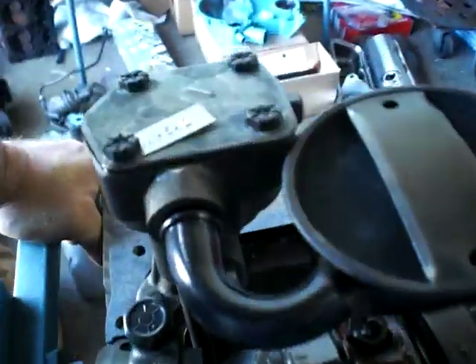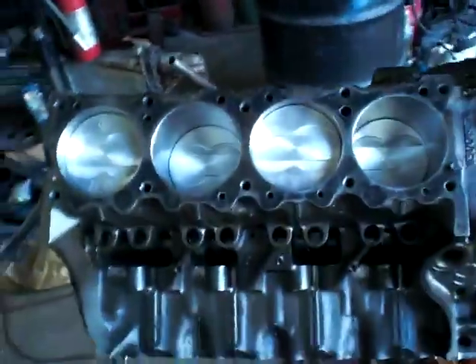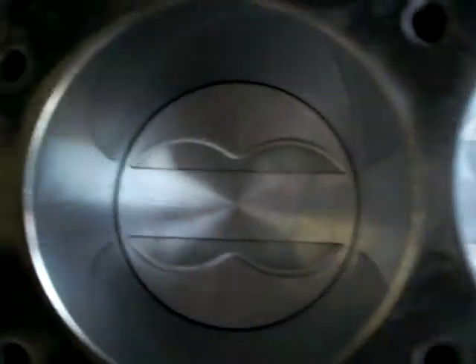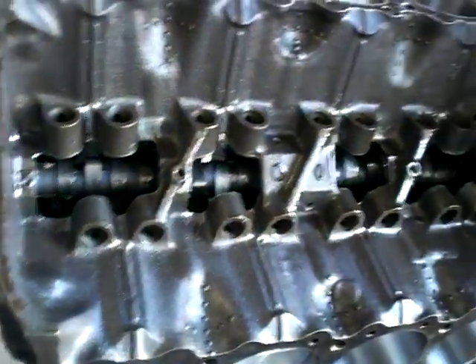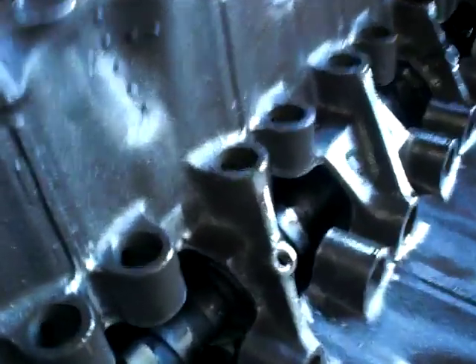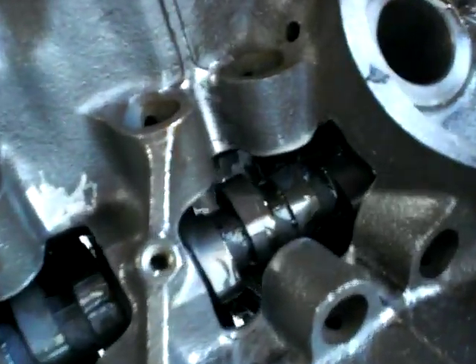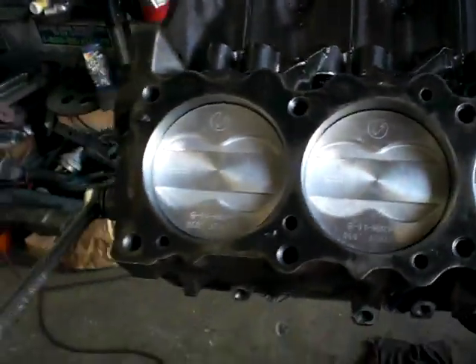The oil pump is new and modified. The bearings are modified. The oiling system of the block is all modified — you can't see it now because everything's put together. I'm gonna turn it over so you can look at the cylinders and the 30-over forged pistons. You can see modifications to the block — the valley area where there was tremendous casting flash has been ground out and smoothed, really nice. There's no casting flash anywhere. The Competition Cams cam is already installed with new cam bearings, and the piston-to-wall clearance is at four thousandths instead of two.